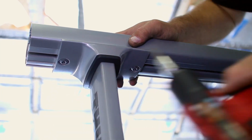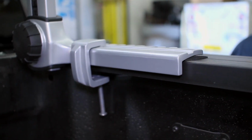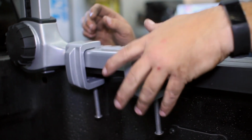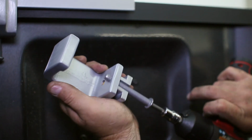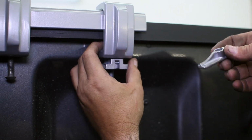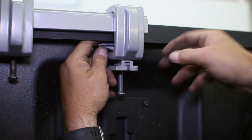If the placement of the rack is where you like, slide on the clamps to the base assemblies with 1 locking clamp on each rack assembly. When tightening the clamps, attach the clamp foot to the top of the bolt so that it can grab the inside of the bed rails.